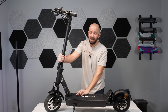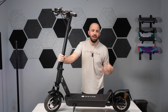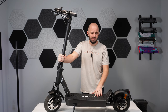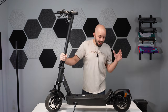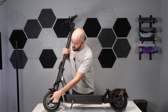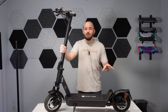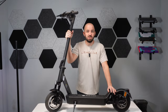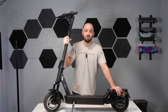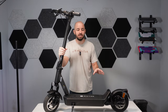Next up, I love the quality of the hot swappable battery area. Once you start getting into this price range the $800-$900 scooters, this becomes a little more common. We have seen it on a couple of cheaper scooters too. Next up, I love that it has good disc brakes. A lot of electric scooters usually have one decent brake, and the other — wherever the motor is — is a motored brake. They work, but they're not going to stop you how you want. I did need to adjust these ones a little bit — my back one was slightly loose. That could have happened in shipping; it's very normal with scooter ownership. If you have disc brakes like this, from time to time you'll have to adjust them, just like a bicycle. Totally normal.